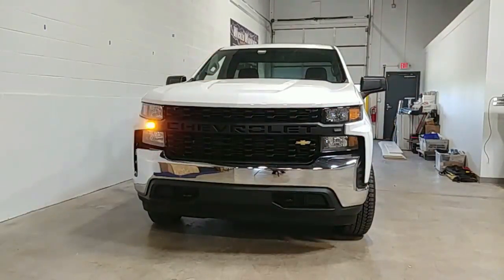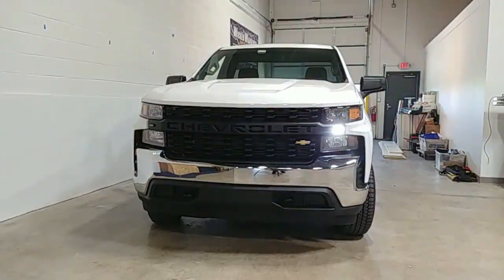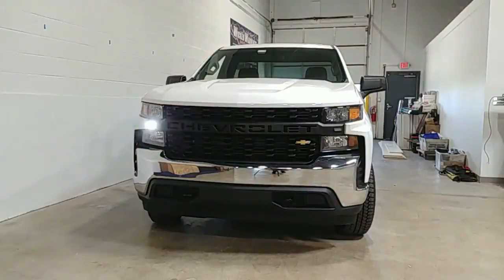It was pretty self-explanatory. That light is a quick mount, meaning it has 3M adhesion tape on the back of it, so I definitely suggest using our primer promoter when you order this package. This particular build is very simple. We used our 22-5, 25 feet of wire, to extend both M-Power lights into the cab, where we hook it up to our three-quarter inch switch. That switch grabs power directly from the driver's side fuse box. So you'll need a fuse tap, a three-quarter inch switch, two three-inch M-Powers, 25 feet of wire, and some eighth-inch heat shrink tubing to complete the job.